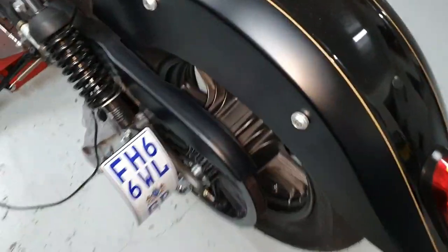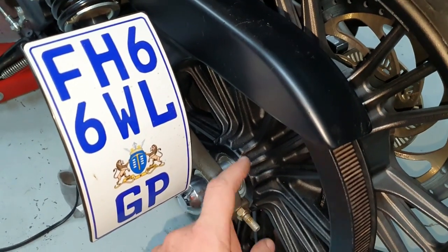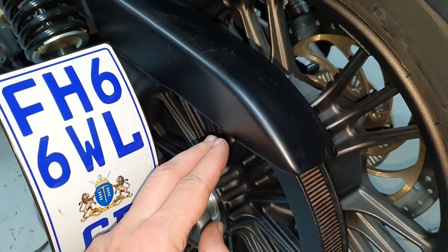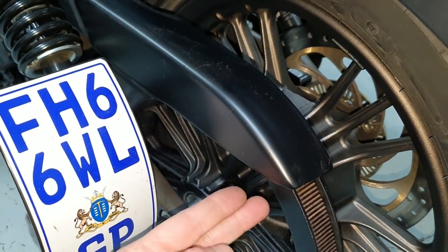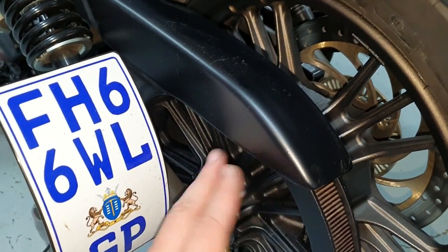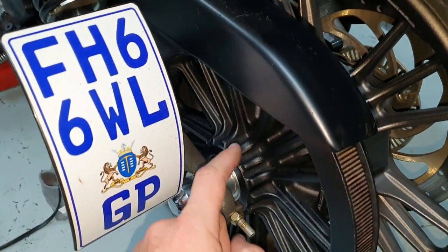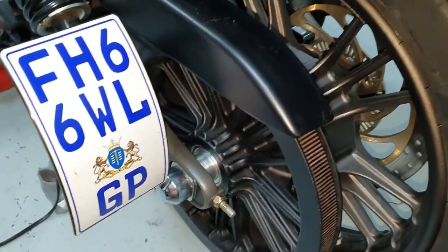Then, coming to the belt drive, was also one of those pains. One of the bearings went, you could turn it, and then it went click, and a bit of resistance, you turned it again, there was another click, and then turned again. So that bearing had either a spot or had collapsed inside, also had to be exchanged. Again, you who painted this, you did the same thing here.